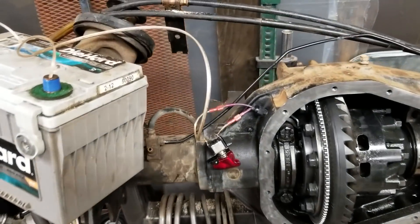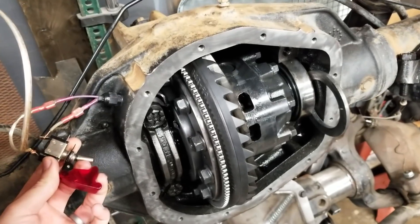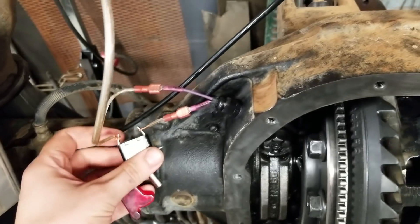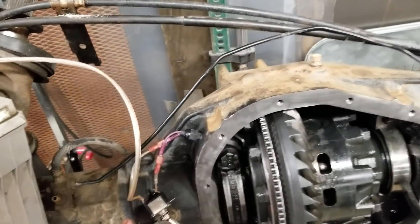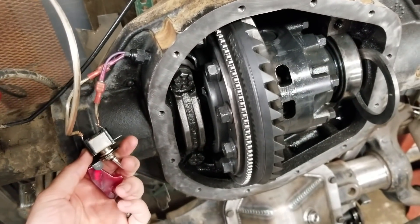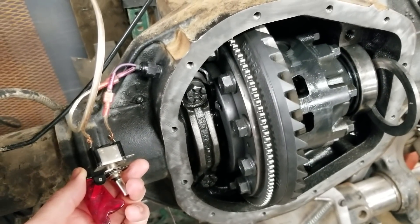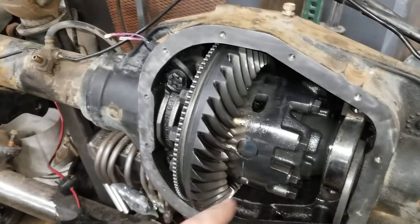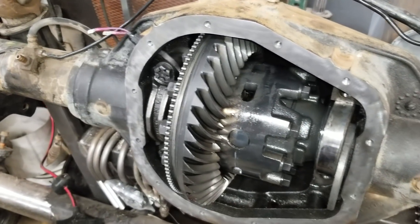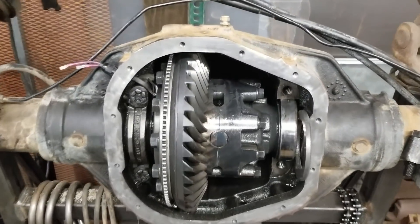There you have it — let's give her a test. Oh yeah! That's a locker. Just to prove a point, let's switch those wires and make sure that there's nothing polarized about this thing. Now the switch is on the purple wire, still hooked up to our battery at the same polarity. That is not polarized — as long as it's got 12 volts going through it, it's actuating. This carrier bolts into all of the Sterlings all the way back to 1985, so even if you've got one of the older axles, this will work for you. Thanks for watching.